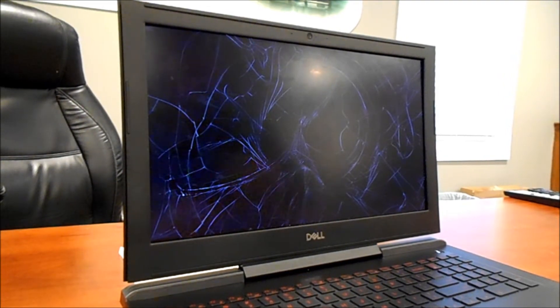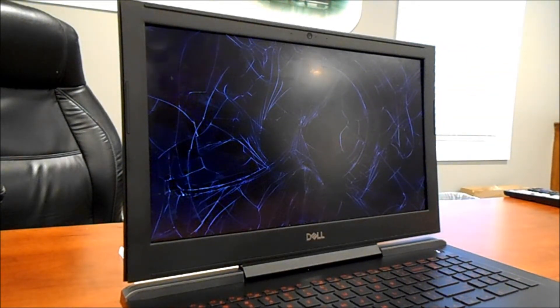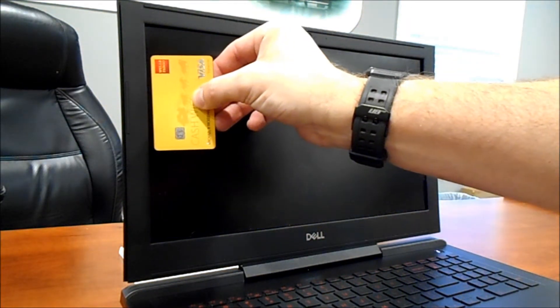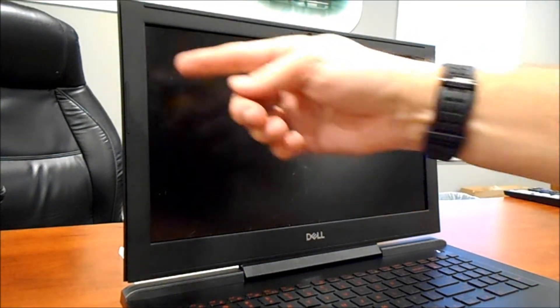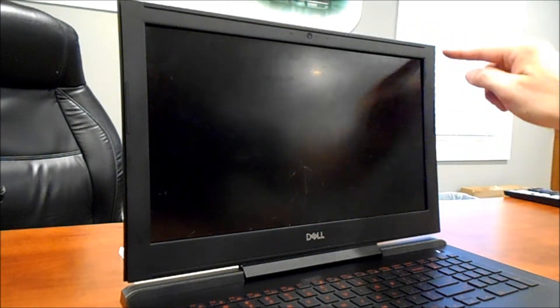To take this plastic ring off, there are a couple of ways to do it. This screen is totally shot, so being really gentle with it is kind of unimportant — it doesn't matter if you scratch it up because you're tossing it anyway. One of the ways that's worked best for me is to just use a credit card and gently slide it in between the ring, the plastic, and the screen itself. These just pop loose — they're held in place by some pins. You have to be careful around the camera and down at the bottom. It's best to pop this section off, go across the top, and then push down and pull out to get that off.